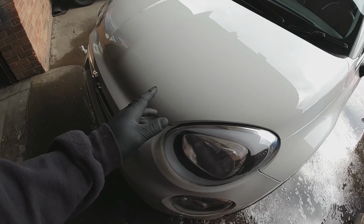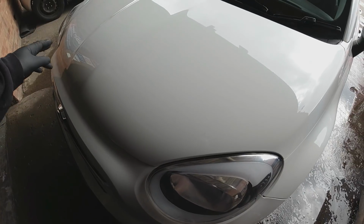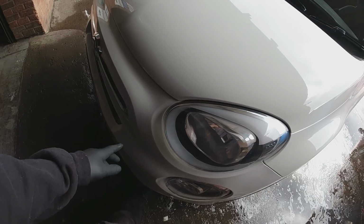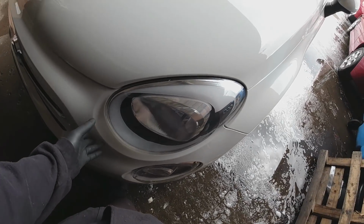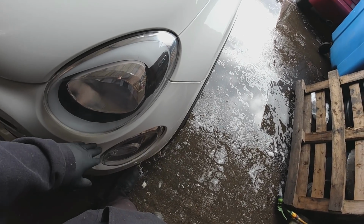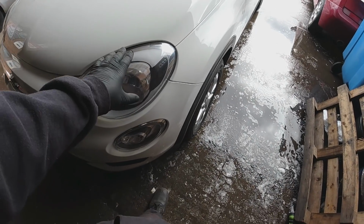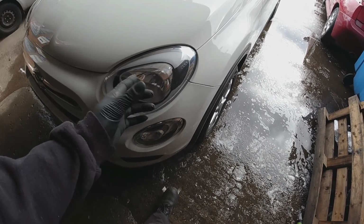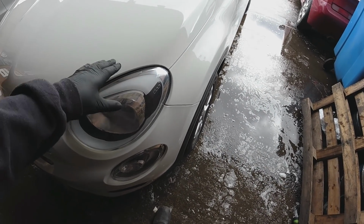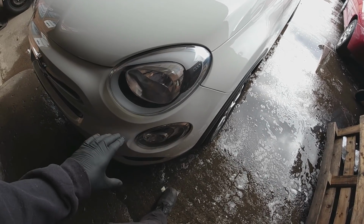The best frontal ones to do are the ones where the bonnet is still completely straight and the damage was lower down, because it's only likely to have dented the crash bar behind and maybe taken the radiator out, but you'll just be able to put the bumper straight on again. The best fixes are obviously where it's just the front bumper and the wings and the bonnet are still straight. But every time you see a car with the headlights in, don't assume you're not going to have to replace them. They prop them back in again and the tabs are normally broken. So either you need to be good at putting the tabs back on, which sometimes are missing completely, or you need to factor in that you might need to buy headlights.